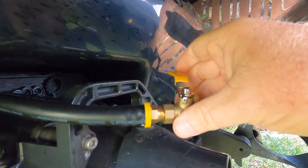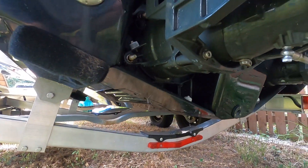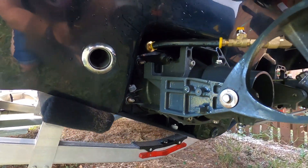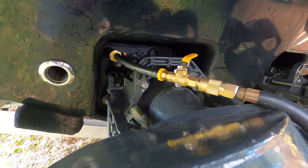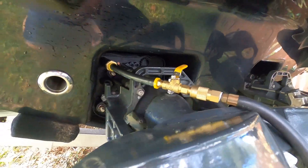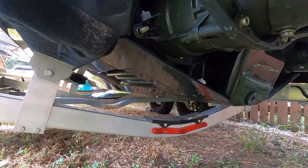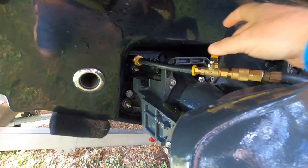That's it — let me show you the valve, just turn it on. You can see it blowing vapors out of the exhaust. Keep doing that until you get no more water coming out and you've winterized your engine — there's no water in there to freeze. I see some people say they like to pull antifreeze in there, but the manual doesn't mention that and it's not necessary. If you do this and you don't get any more water out, there's no water in the system to freeze. Air is better than antifreeze.